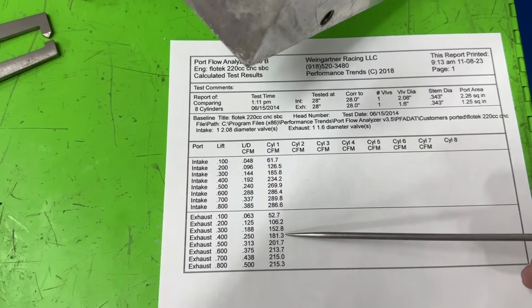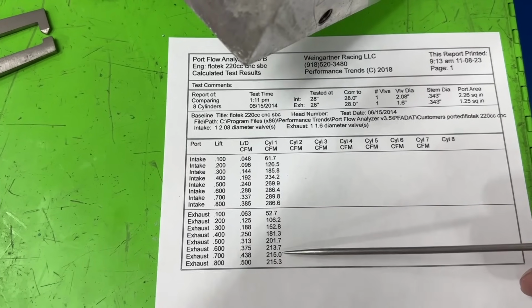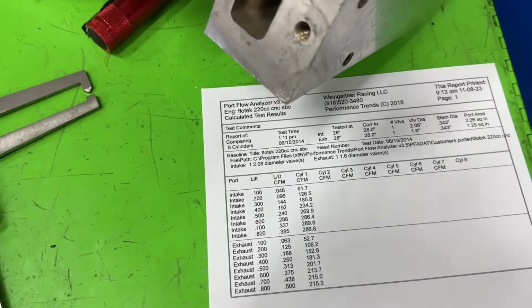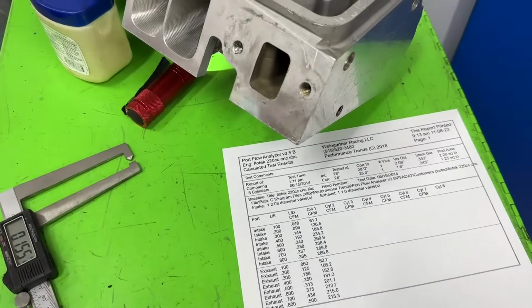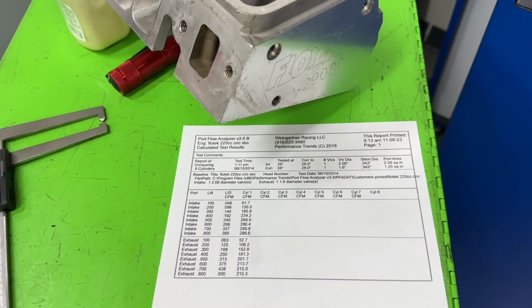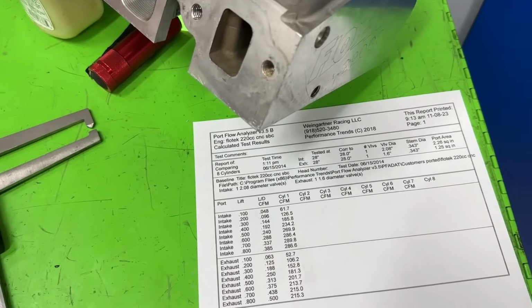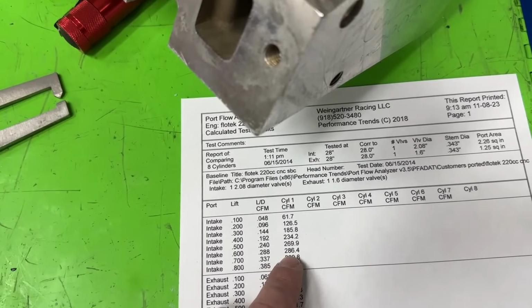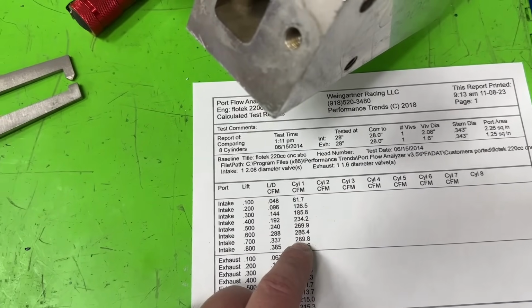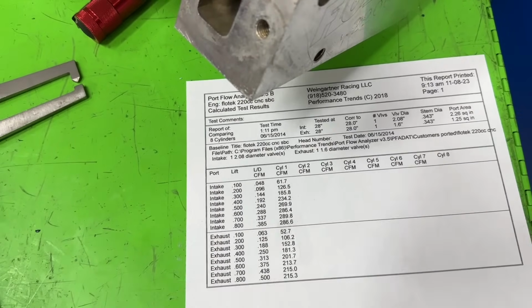Exhaust, it was pretty good though. Exhaust really is good. You got 181 at 4. That's a great number there. And it peaks about 215. So pretty good number. And that's without an exhaust pipe. So that's a really fair number. Things that could help this easily: if you just put a back cut on the valve, that would have helped out that one. As far as the 600 number, it probably wouldn't have changed that at all. It would have remained the same. The 700 number would have probably lost 2. So going from 289.8, we can say 290, it would probably have been 288. So anyway,